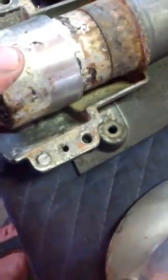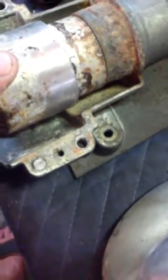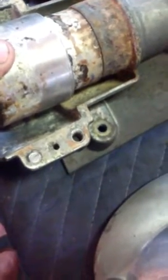But when I took these clamps off, there's a lot of corrosion on there. So this is another place where the water can get in. You can have a leak around this. It definitely was leaking. You can see how bad it's corroded. And here's the bearing side. It definitely was corroded. Water was definitely getting around that ring there, that sleeve. And that goes just like this. That sleeve with the two clamps joins these two pieces together. So I was definitely getting water in through there. But this was the main problem.